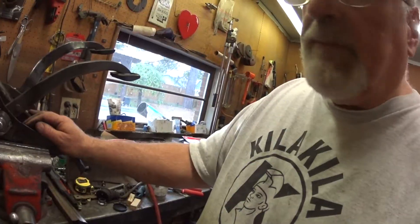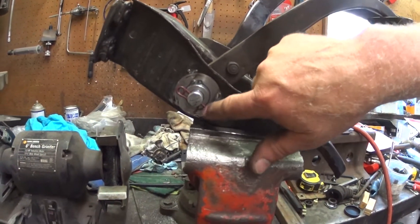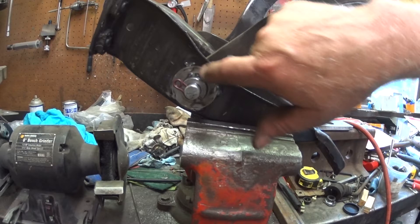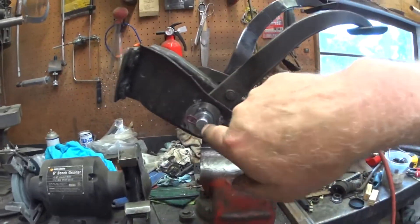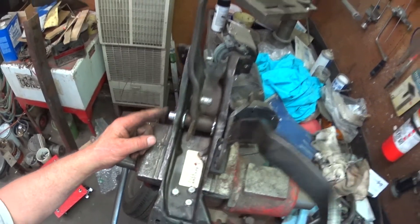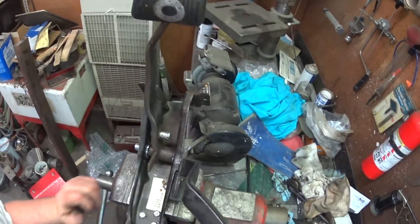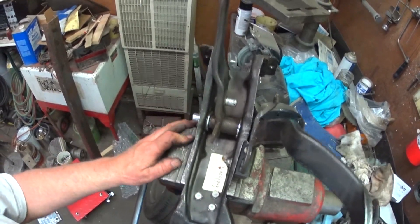The pedal cradle — my suggestion is, weld it. I ended up having to turn these washers in the lathe. I had to turn those washers down because this is the Shelby bracket, and the metal is thicker than the Dash A bracket. So be aware — the kit is designed for the Dash A bracket. And then sort of bending the metal on the cradle until the bearings were in alignment with each other. Be aware, the cradle sits crooked in the car, and the shaft runs crooked in the cradle in order to straighten out the pedals for the driver. So when you're doing it, make sure you maintain the angles, and it took a little bit of work to get it in there the right way so that everything is perfect.